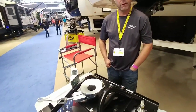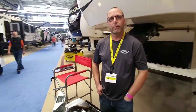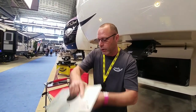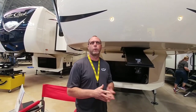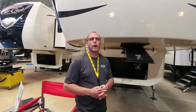It's a really cool product. I use the goose box only because I like my open bed, but if that wasn't a factor for me this would be a really good hitch to look at. Some of the benefits of towing with this versus a goose box — you might get a little bit tighter connection up here because when the ball goes into the socket we've only got two thousandths inch tolerance so we don't get any bumping or chucking. The other nice thing is when you put the goose box on you can only tow the trailer with a gooseneck hitch. With this you can still tow with a regular fifth wheel hitch or this style hitch, so it gives you more versatility and it's going to save you a couple dollars over towing with the goose box.